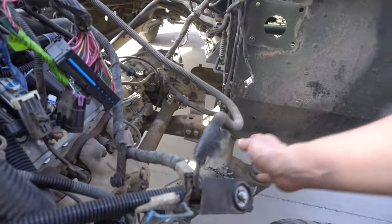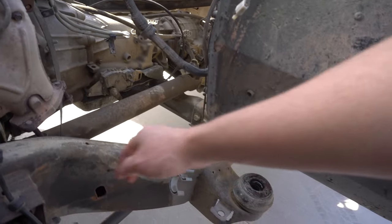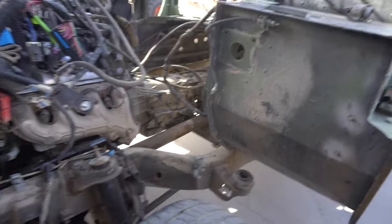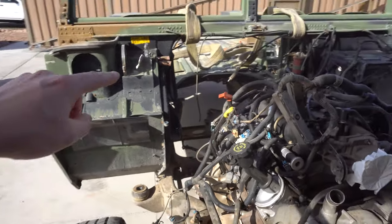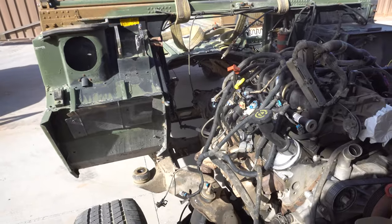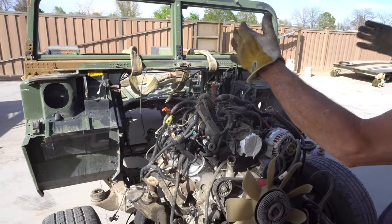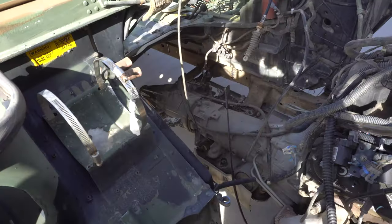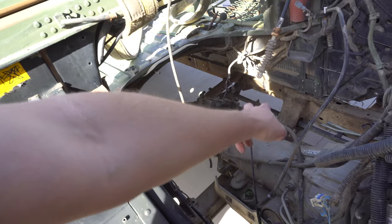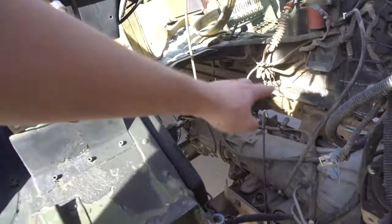All he's worried about is getting rid of the front gearbox and axles, probably going to a coil-over type spring up front. The torsion bar will go away, which it needs to because the frame needs to come all the way in. This is about the width of the frame — it's gonna travel all the way down, so the step-out won't be used anymore, just that flat spot. The frame will shoot straight back and that helps get underneath the Hummer's big wide tunnel. It has to be 35.5 inches on the outside of the frame — right now it measures 50 inches — so you gotta take a bunch out on the Suburban. That big main brace is gonna get cut out of the frame too, and then he'll end up making a new trans crossmember.